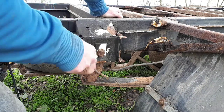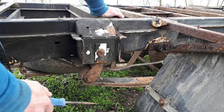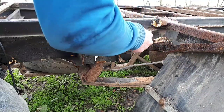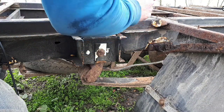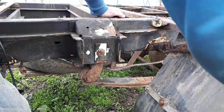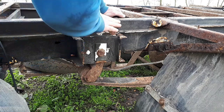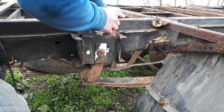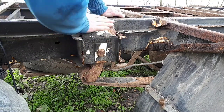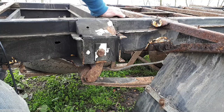These are all going to want shot blasting up, and I think I'm going to have to get some new leaf springs, because I think those leaf springs are about had it. But once I get these bits all off, grind them pot rivets off, that'll come off. These are proving a bit tricky up the top to get off. You can see how much of it's falling out when I do that. It's quite shocking really, but yeah, there's more of the chassis with this black stuff on than there isn't, so I'm quite pleased with that. It comes off quite nicely actually while it's cold. Yeah, so I'm quite pleased with that. Lovely jubbly.